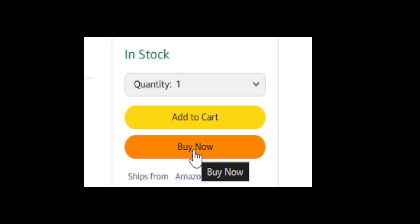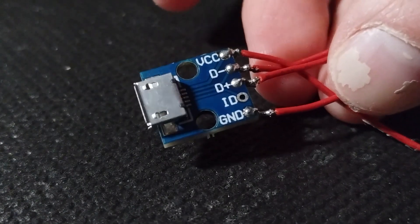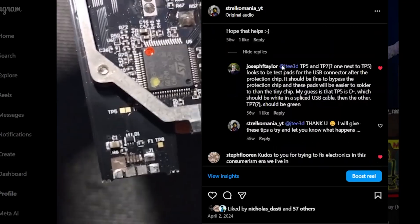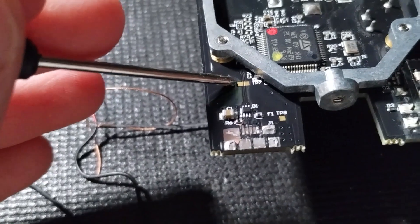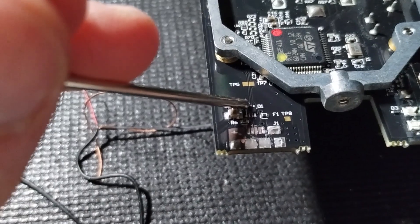Work simply replaced the mic by hitting buy on Amazon, but I was determined to salvage this broken friend. With the help of you guys and my multimeter, I figured out where else I needed to divert the ground, 5 volts, and data pins from the USB.